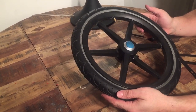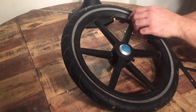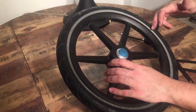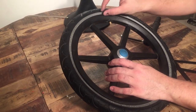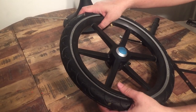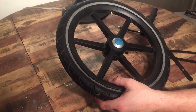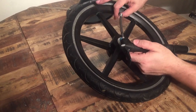Before you pump, look at the tire in relation to the rim and check that you have an even distance all the way around. This is one reason why the outward-facing side of tires has various rings — it makes it easier to see that the distance is even. This is especially important with a jogging stroller, because if it's not even the wheel is going to limp along and that will definitely affect performance.